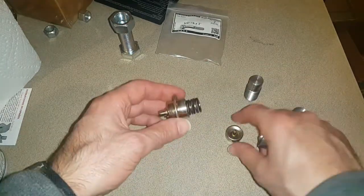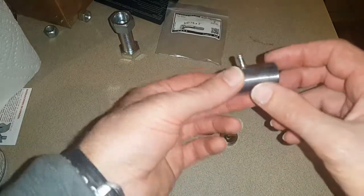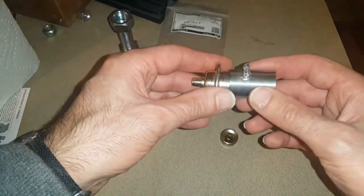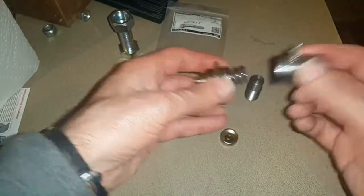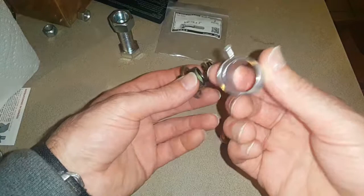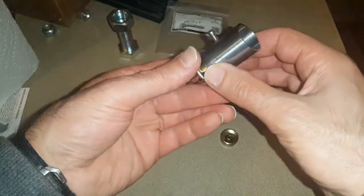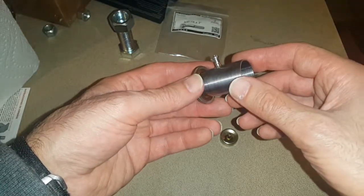So what I did is I first began by cutting this open, and then you've got to turn a piece to make this longer. The trick about this is that you have a bracket which comes over here, so this thing has got to be very, very fine — cut with a very thin wall — so that when you put this over, the total diameter is enough to get this bracket over there. And I think I've managed to achieve that.